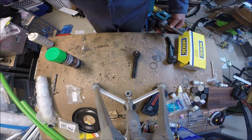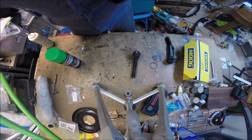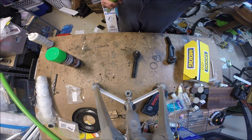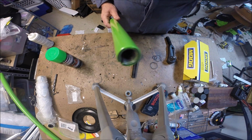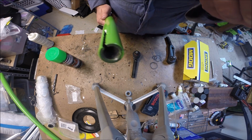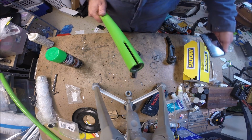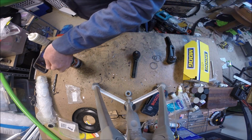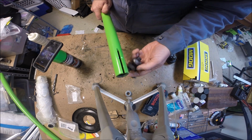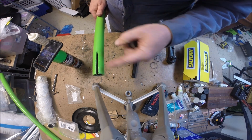One of the other reasons why you might want to go with Rugged Ridge is that it is also DOM steel with the same dimensions as the Aries setup, right? So it's 1/4 inch thickness steel, but there are a couple of things that make it a little bit weaker than the Aries setup. If you look at that, they cut a slot right there, because the way Rugged Ridge has it set up, you use these clamps to tighten the tie rod ends in place as opposed to a jam nut. I don't like that. That's suboptimal. These things can fail.